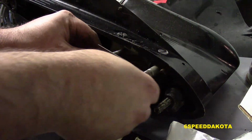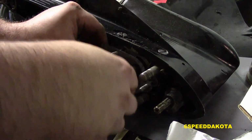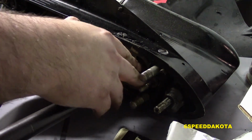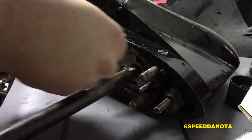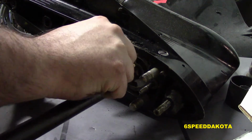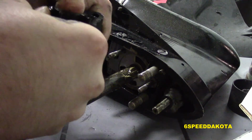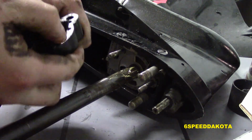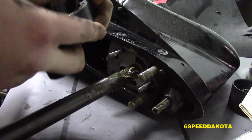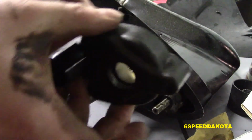And we're going to put on our new base plate and gasket. And then the gasket on top of that makes it to the water pump housing. We're going to put a daub of grease to hold the impeller key in place. This does not come with a new one, so keep it and reuse it. I like to squish the impeller into the housing before putting the housing on. I just found this has worked much better for me. A little bit less wrestling.